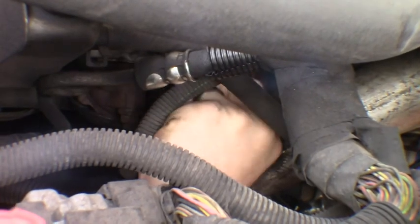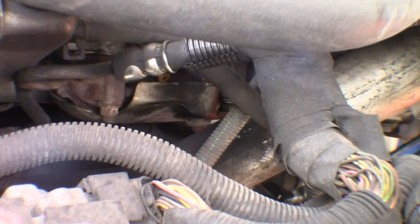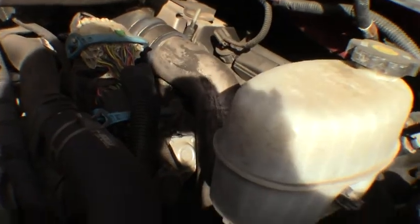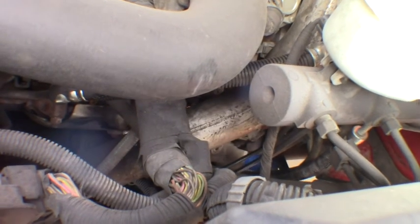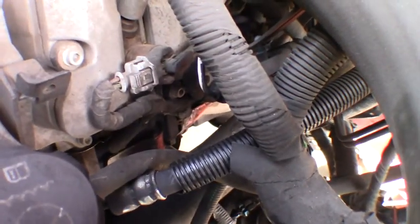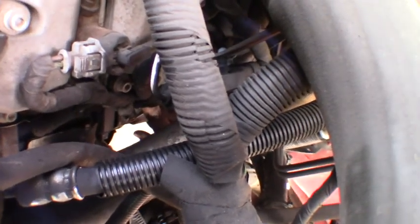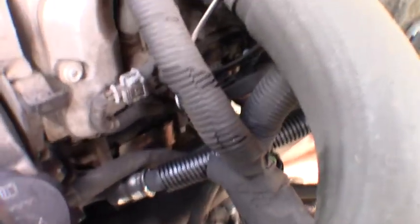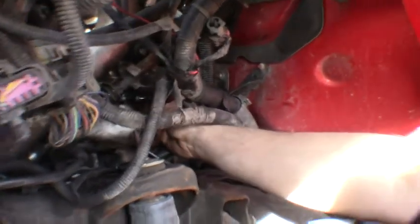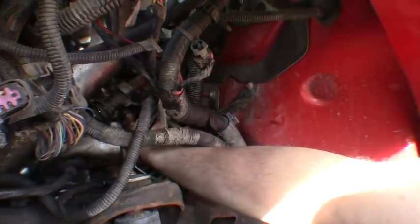Seven down like butter and one to go — and you save the most difficult for last. Last one, guys. You've got your steering shaft and your hot-side intercooler pipe in the way, but there's some flex on that intercooler pipe so you can work in there. It's absolutely impossible to film, so here we are on top of the motor. To get that one you have to come from the top right where my fingers are and reach down in, because there just isn't room for a straight line at that thing through there. Anyway, we got them all out and we're going back in.